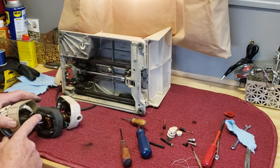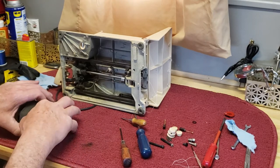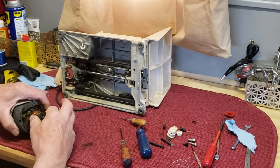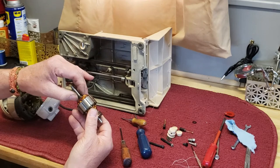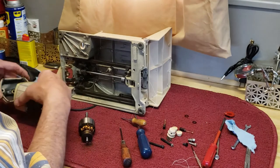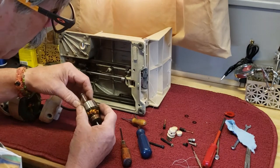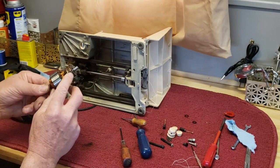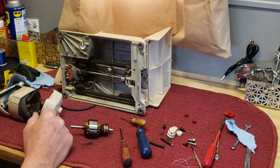On the other side, two wires come off the winding and attach to the receptacle block. Now, if you move everything out of the way, you can pull the armature out. There is a fiber washer here that you don't want to lose — there is usually one on either end. I'm going to put this in the drill and spin it and use some super fine sandpaper on it to smooth it out. Just chuck it right into your drill, tighten it, and then we want 500 to 600 grit sandpaper.